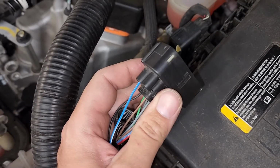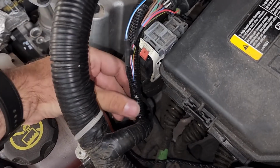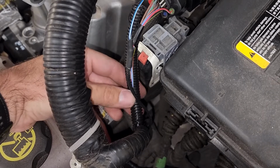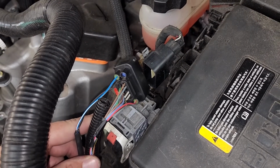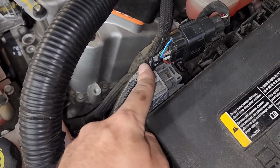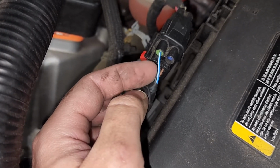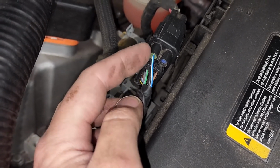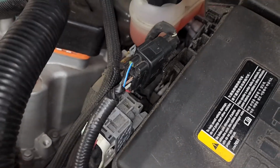Then I'm going to wrap this back in the electrical tape after I pulled off all the rest of it to clean this up, and then plug it back in, and hopefully it'll work. Wrap that wiring loom with fresh electrical tape. Again, this is the 2 wires you need, the black wire and that connector, and that blue and white wire in this top 8 connector.